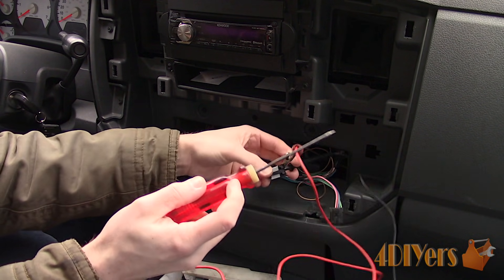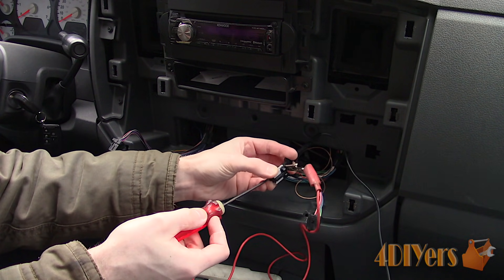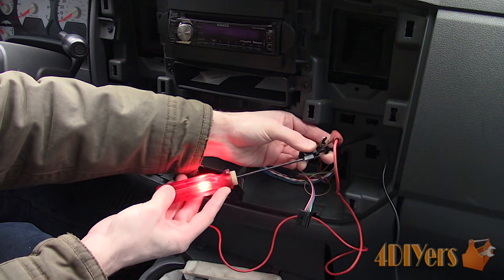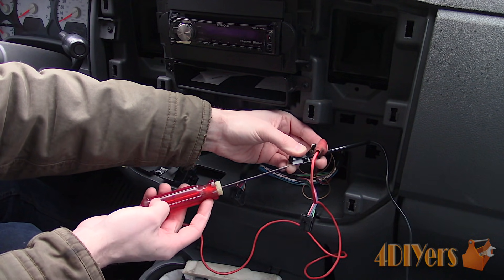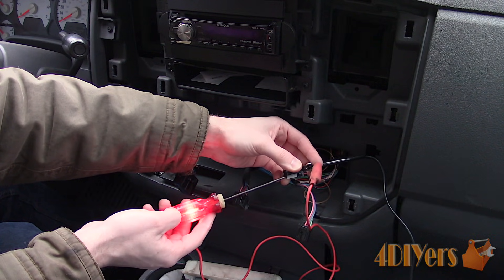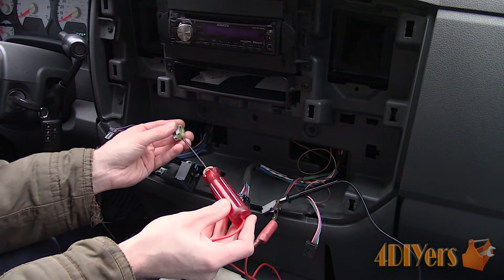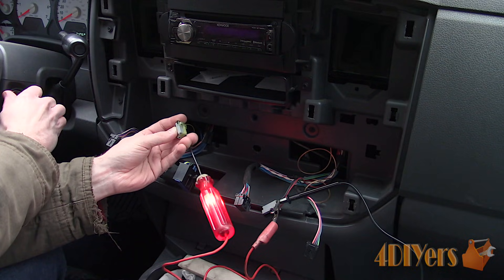Using a test light, this too can determine a switched power source along with polarity. Instead of hooking up both wires to the plug, the test light can have the negative wire connected to a known ground source — this can be another connector, the battery post, a body bolt under the dashboard, or a bare metal bracket. It's best to verify the connection with a reliable power source such as a battery. With a known ground source, the light will illuminate when it contacts a live power wire. As you can see it powers up on the non-switched 12 volt power port wire but won't power up on the other one when the key is off. When the key is operated on and off you can see the light turn on and off. The wire at the connector being tested is the power wire; the opposite is the ground.